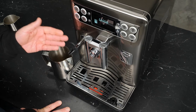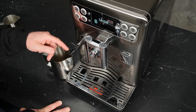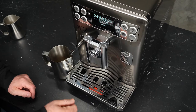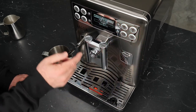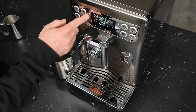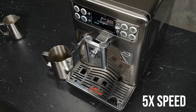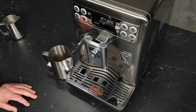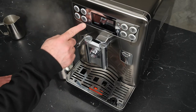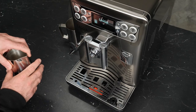If you're going to steam using the manual wand, one thing you want to do first is purge it out — there's always going to be just a little bit of water that's condensed in the line. We'll go to our special drinks menu and click steam. This will take a moment to heat up the first time but the second time it will go much faster. As you can see, just a little bit of that condensation is now out of the line. We'll hit stop and get our pitcher in place.